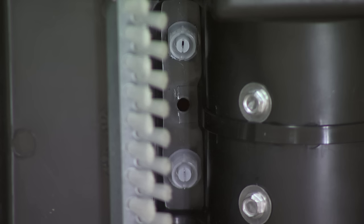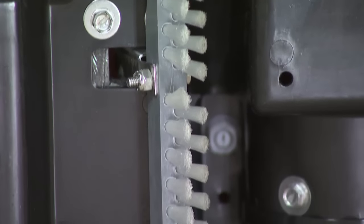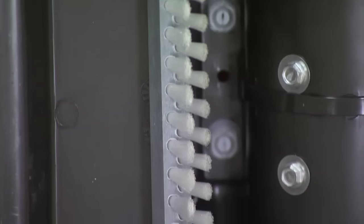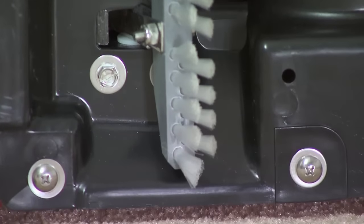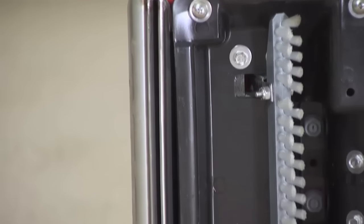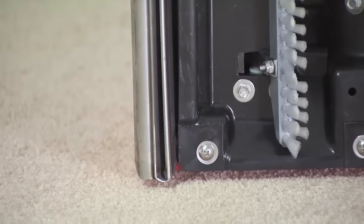When it's operating, these two needle jets deliver measured amounts of Rug Doctor cleaning solution to the carpet pile. This row of unique bi-directional brushes oscillate at 3200 cycles a minute, so that every side of the fibre is cleaned thoroughly. No other carpet cleaning machine has this type of deep cleaning action. A powerful vacuum extracts up to 80% of the used cleaning solution, so that the carpet is almost dry immediately after cleaning.